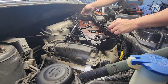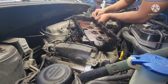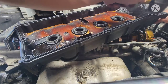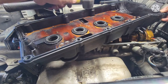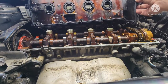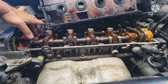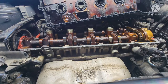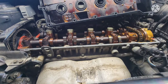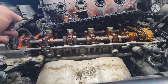Set the main gasket in place, then hit it lightly with a rubber mallet all around so we know it's fully seated on the hole — not too hard, just a little bit. I'm going to wait a couple more minutes. You can see it's not sticking anymore — that's what we want. When I touch the silicone it's not sticking to my hand. The engine is hot which helps dry and cure the silicone.